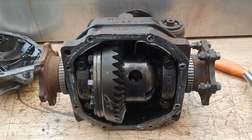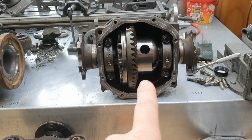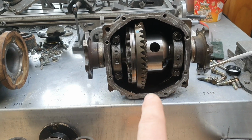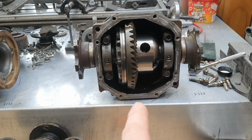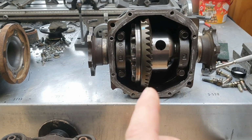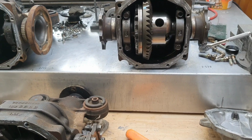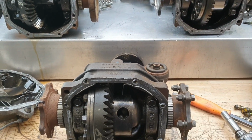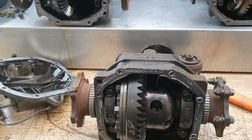Because of what we're doing, we're losing some revs in our prop shaft. So with that diff, everything the way it is right now, we can do a theoretical max speed of 260 kilometers an hour, which we nearly got to at Pukekohe with 250. If other things had been a little bit better, we might have got knocking on the door of 260. But as you might appreciate, it takes quite a lot of ground to gain a little bit of speed once you're going as quick as that.